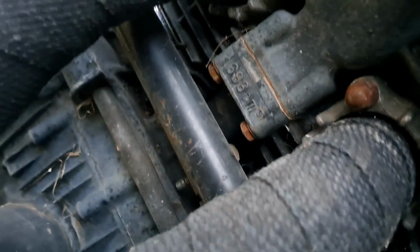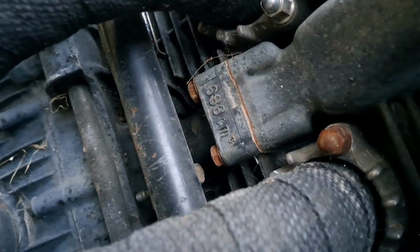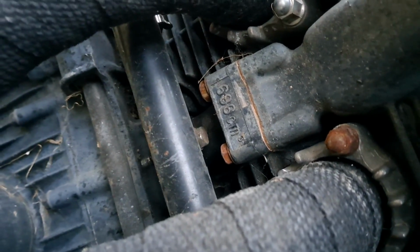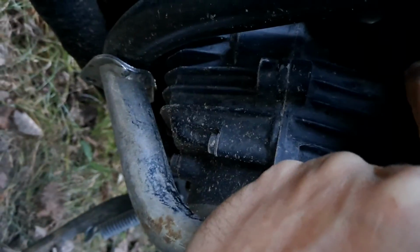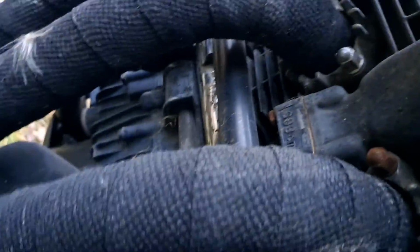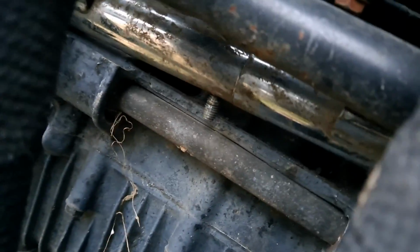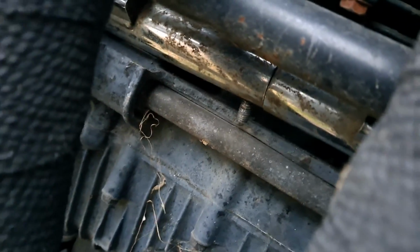But you put it in where it's just out of the way of this chain case bump out, and then once you've got that, you'll slide it back in until it's about in the middle, and then your crash guard will be all lined up on the lower left side, and then it'll be all lined up on the right side. And then once you've secured your U-bolt here, you bolt in the other half. Now you can torque down that bolt and nut here. That guy, you can see it moving.